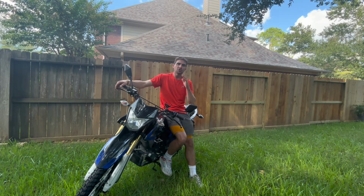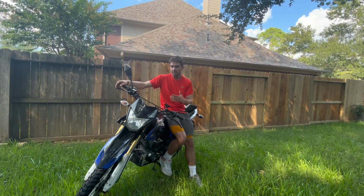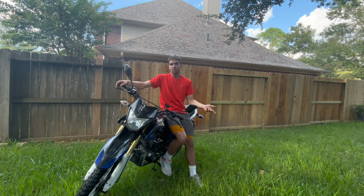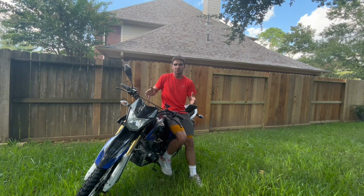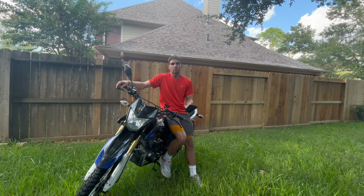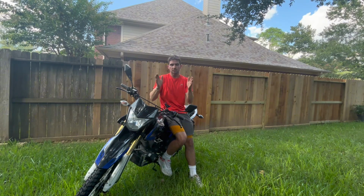Last thing, and I'm going to bring you close up on it so y'all get a better picture, is the wheel. Now I opted to use the old wheel from the Hawk X because I wanted to maintain the mechanical drive speedometer. If you're using the Hawk DLX wheel or you go to an electrical dash, you don't have to worry about that. Just slap the Hawk DLX wheel in between the forks and you're good to go. Now one quick thing to note, if you're trying to maintain your stock Hawk 250 or Hawk 250X wheel, it is shallower, right? It's not as wide, sorry.